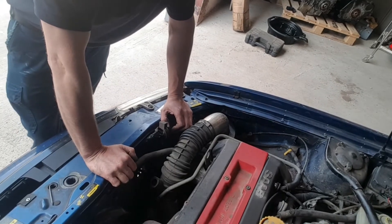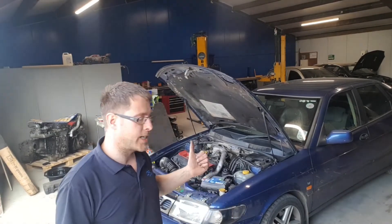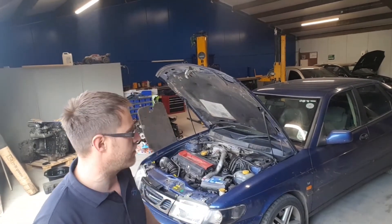So just one more thing — let's road test and see if the actuator is up to the boost pressure now. Just got back from Rochester. I had a Stage 1 warm map on it with the T5 APC, getting about 0.8 bar, and it wouldn't really go any further on that map. So now I've got the T7 mod with a Stage 3 map on it with sports mods. She should be rolling on the engine at about 270bhp now. Obviously I'll get it on the dyno, but that engine is coming out because I've got a fresh engine — you'll see some videos of it. So that's the end of the cool-down now. The trouble is more power means wheel spin — can't get it down. Next step will be to tyre up very quickly. I hope you liked the video guys, stay tuned, please like and subscribe. Cheers.